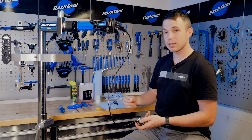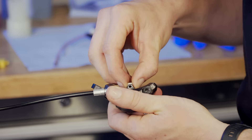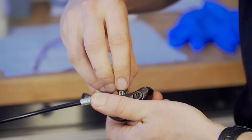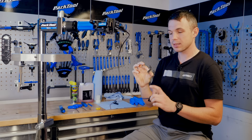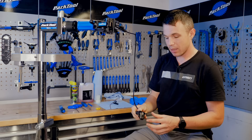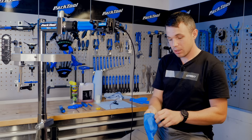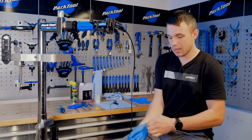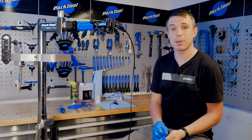Before starting, I've washed my hands. If you want your brakes to run as best as possible for as long as possible and you want to reduce the risk of contamination — it sounds obvious — go into everything with clean hands. Be careful how you handle your brake pads: notice I'm touching the back plates and not the braking surface. Even when you lay them down, put them somewhere clean. Then I'm going to put my gloves on to handle the caliper, so my hands go in clean and come out clean when I need to handle the pads again.